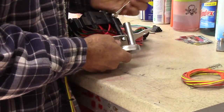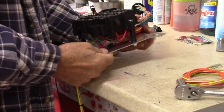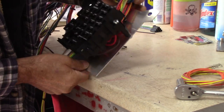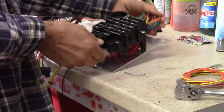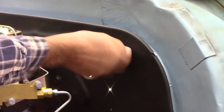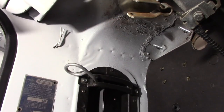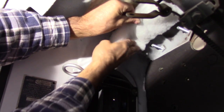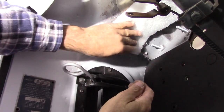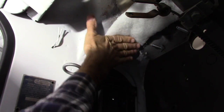That's what we're looking like after the plate's on. The one here on the bottom — that little rubber piece is like a cushion that hits the firewall. Remember I don't have my inner fenders on, so these will be coming back off later when I go to put them on. I always like putting a little bit of padding up there to give them wires something to rest against, to keep them off that hard metal. Pretty tight fit when it comes around, so that should help.